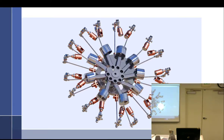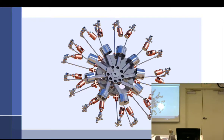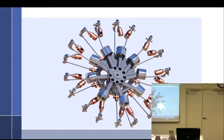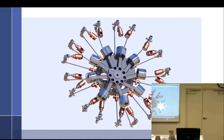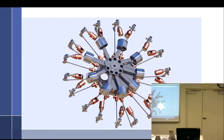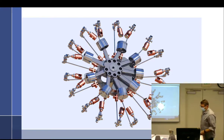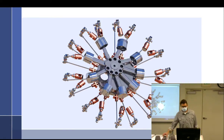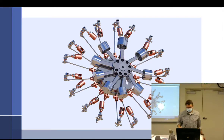If you take a cylinder off the master rod, it allows the master rod to rock back and forth. When it rocks, it pulls the piston slightly further than it ever went before. The rings at the bottom of the skirt can pop out — you'll hear a little 'ping.' When you put the cylinder back and turn the prop, those popped rings get sucked back in and blow out all over inside the engine. When working on radials, know where the master rod is — the master rod cylinder comes off last and goes on first.